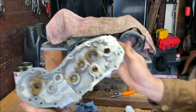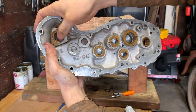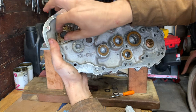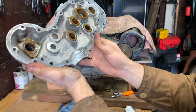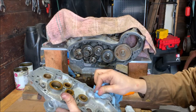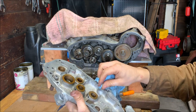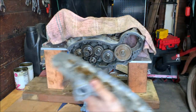All right, I lubed up all the bushings on the cam holder. For this piece, you just want that to be free. You push it down and it just returns. And I've cleaned the whole passageway. We'll put the breather tube on after. Oh, this surface actually needs a little sealant right here around the flutter valve. Let me seal that.